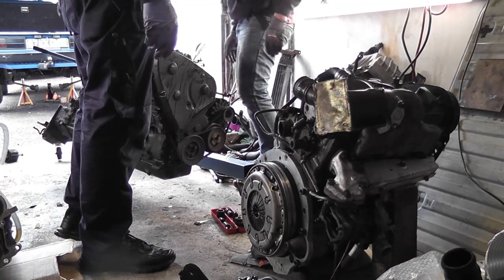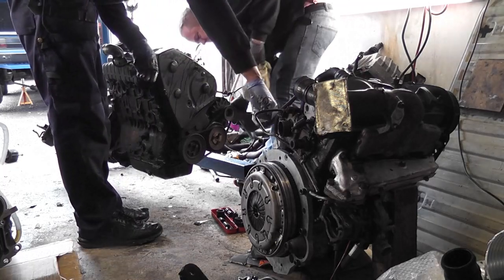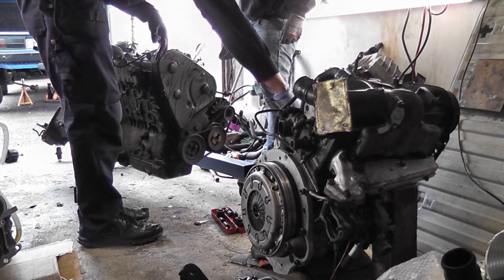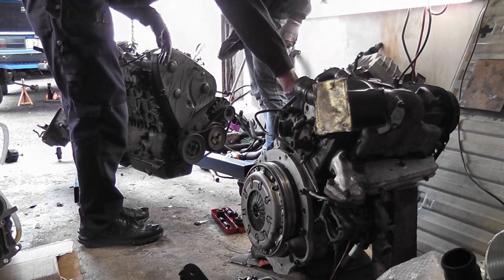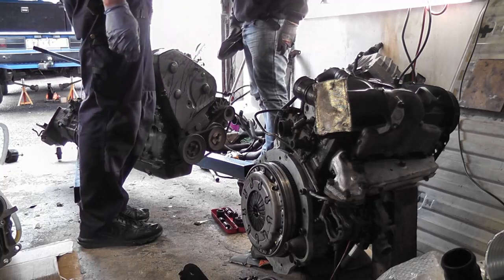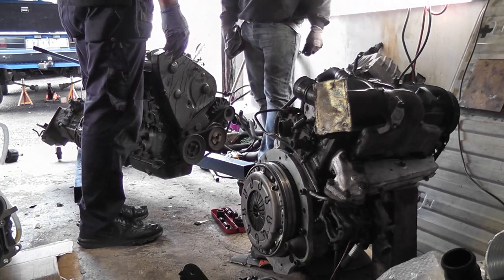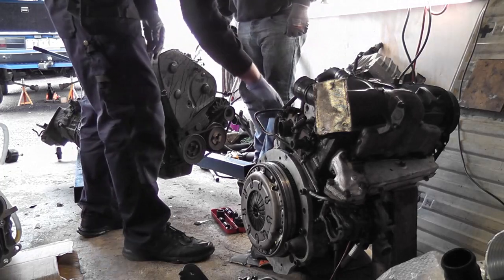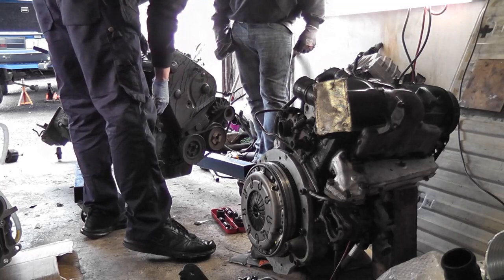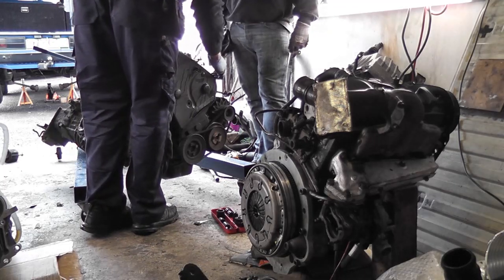Actually, to be fair, I'm just looking there now. I see the oil water heat exchanger needs to be turned on the new engine as well. See this part here? Those pipes are coming out here. It's not a problem. Worst case scenario, we can use the one off this engine. I just realised the implications of that mean that I now need to redo the turbo oil feed, unless that swivels independently, which would be good. Well, it would have to, otherwise you'd be turning the whole flange.